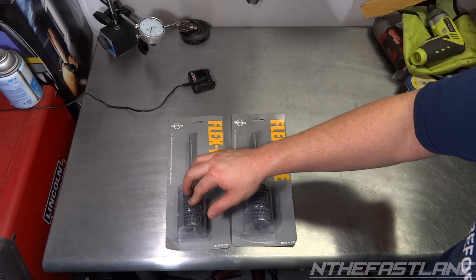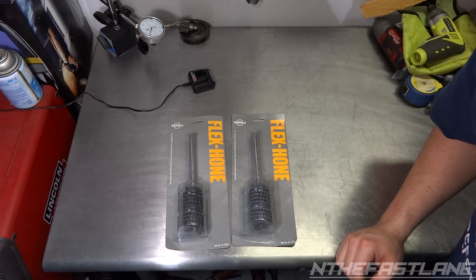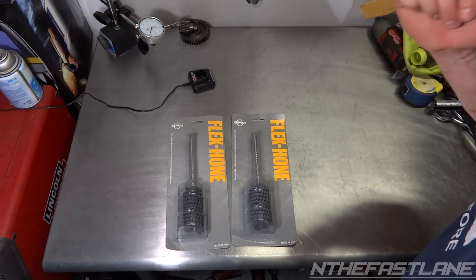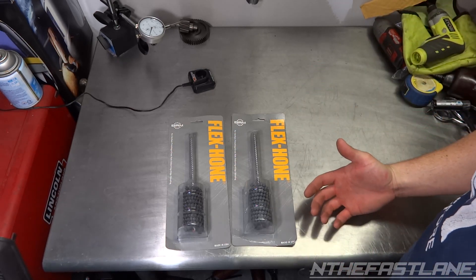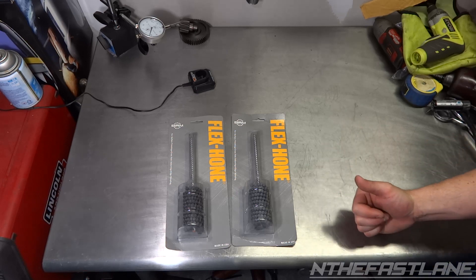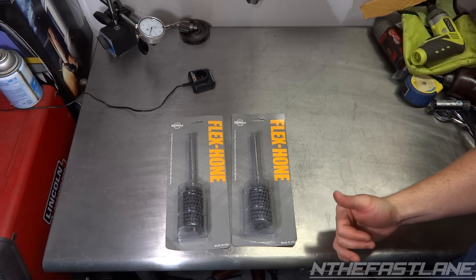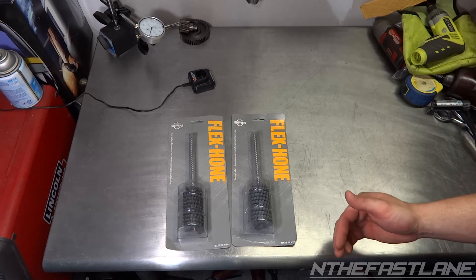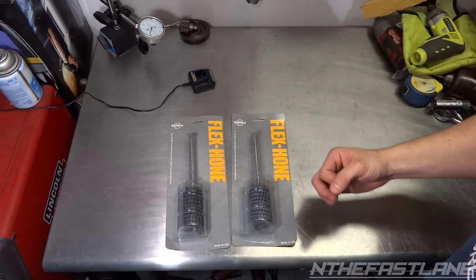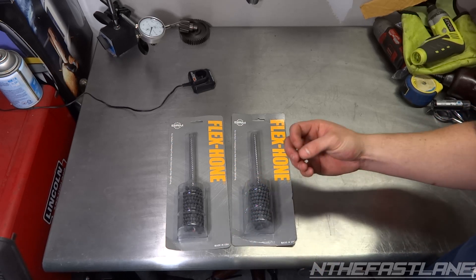Most people go with a 60 grit — I couldn't find one that's a little bit more abrasive, but that's the finish they kind of leave on the heads for the intake side because of the fuel mixture. But we're dealing with an exhaust right now so we don't have to worry about it — we want that thing as baby smooth as possible. Also, we're not actually porting the head so it doesn't matter how smooth the exhaust is. For the intake manifold, same thing — if we're not actually porting the chambers in the head where the valves are, it's not going to interfere with the fuel mixture. It pretty much just shoots out at the edge where the intake manifold flanges, so it doesn't really spray inside the intake. A little bit probably gets in at the tip but it's not really gonna interfere because it's already a certain grit inside the head.